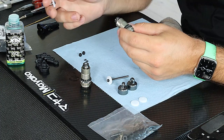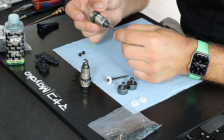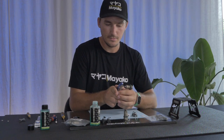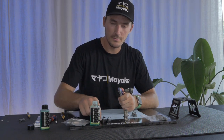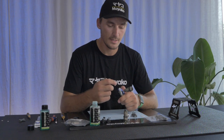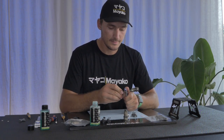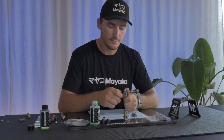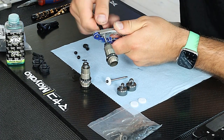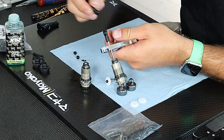Since I used oil when mounting the o-rings into the shock cartridge, you don't need extra lube — the shock shaft will slide through nicely and smoothly. I usually always run the short shock ends both front and rear. If I want to go to the third insert location on the suspension arm, I use a longer shock shaft but still run the short shock end to get more up-travel. Running the long shock end sacrifices up-travel, and I think the car runs better with more up-travel up front. You can chamfer the edges with an exacto knife to make it easier to get on.